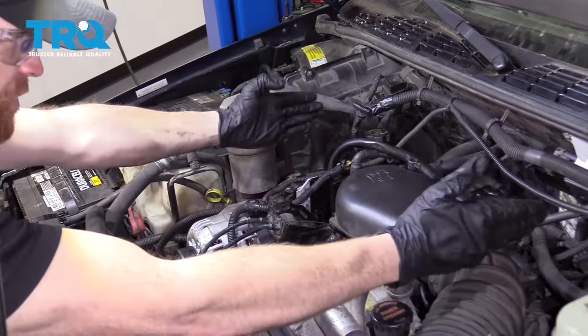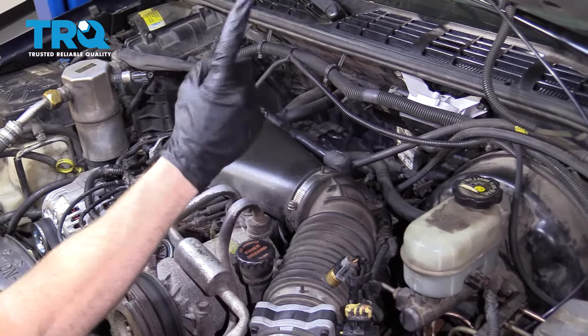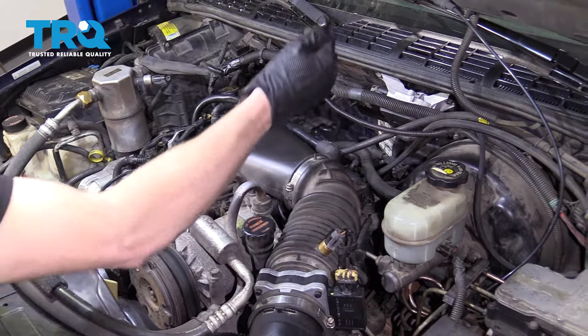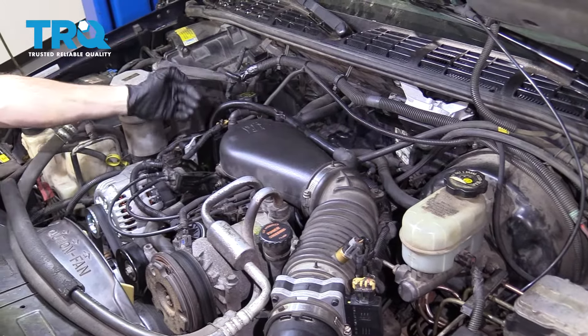The spark plugs going along each side — for the driver's side it's gonna be the odd numbers, and on the other side it's gonna be even numbers. So we're gonna go one, three, five on the driver's side, and two, four, six on the passenger side.